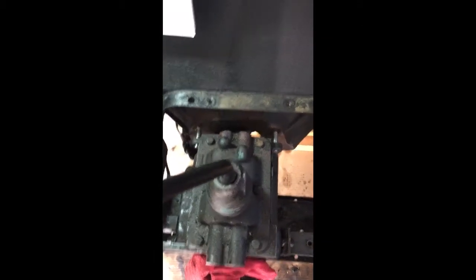As you can see, I've finally been able to free the shaft from the bell housing, and the transmission is sliding freely. What was preventing it from coming off was that bracket that I identified underneath the transmission that was supporting the slave cylinder.